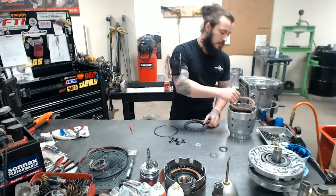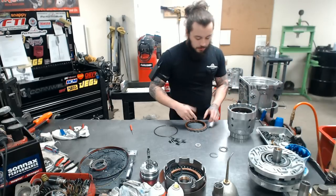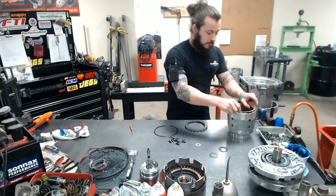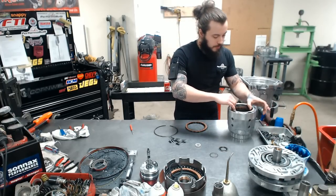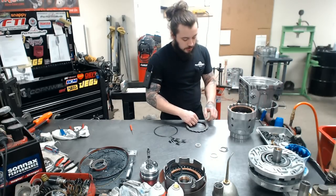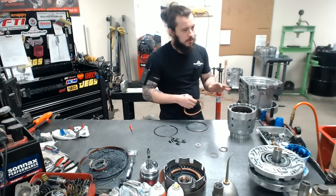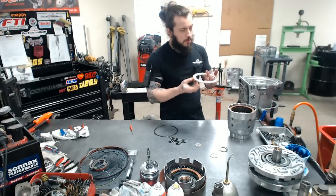Now, you guys have watched me do it live before, but I'm going to get this right the first time because I already did it prior to the video. So what we have here, and what you will be looking at, is a 20 thousandths clearance. Once it sets, it might still be 20, it might be 30, but I wouldn't say any more. And then we have our apply plate.